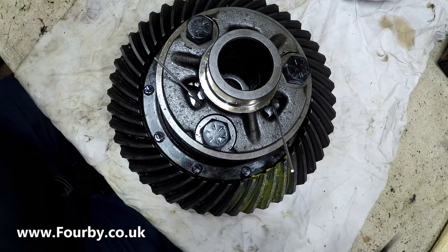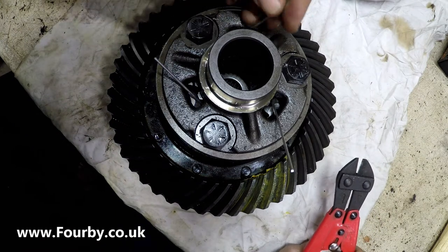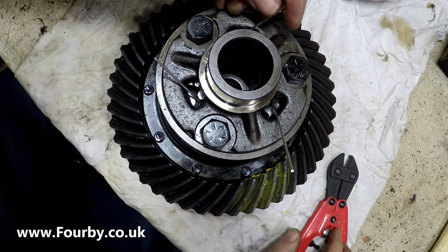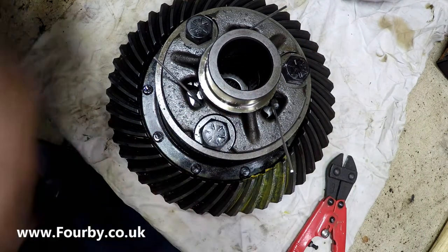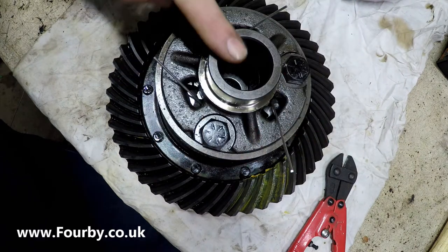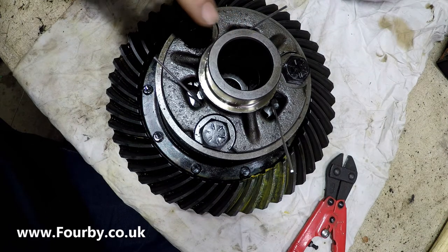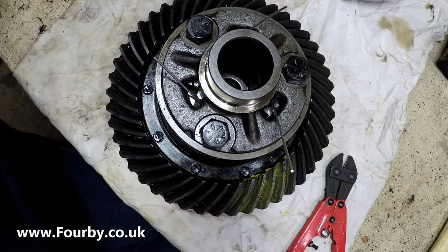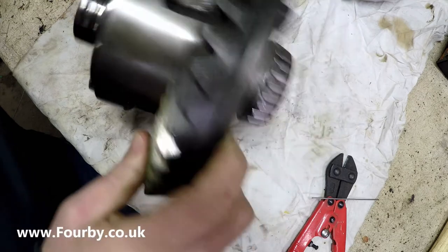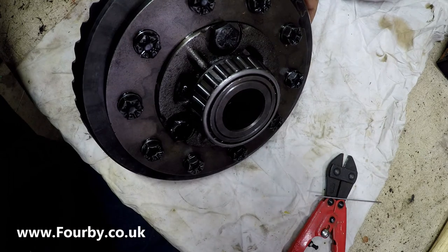Right, okay. There's three pieces in. So what we're seeing is the rotation of the inner gear here. It wants to rotate clockwise to come out, which means that this diff carrier is definitely set up to be rear. So we're going to have to pull this apart and swap over the gear sets from one side to the other, which means I need to put it back in the vise and pull the bearing from the other side, which I've not yet done. It's still on there. So let me do that, and I'll be back with you in a second.